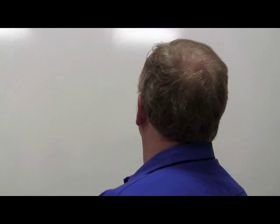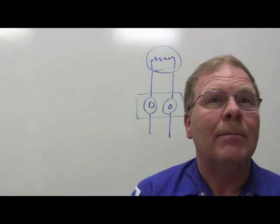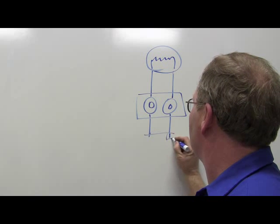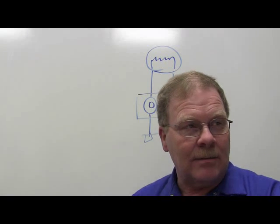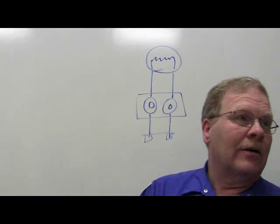And that light bulb, and I'm going to put this, you know where my blown fuse is? My blown fuse, you know the fuse you put in and it goes pop? All right, I'm going to take my blown fuse and I'm going to shove this down in there so that I'm in both sides of that blown fuse place. In place of the fuse, I'm putting the circuit breaker and the light. Now that short circuit, it's now going through this circuit breaker to ground.